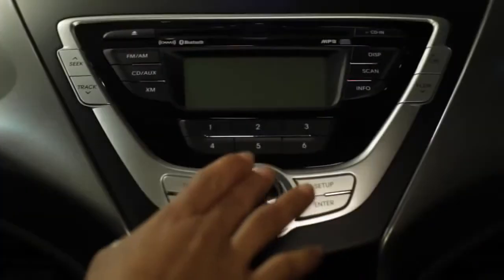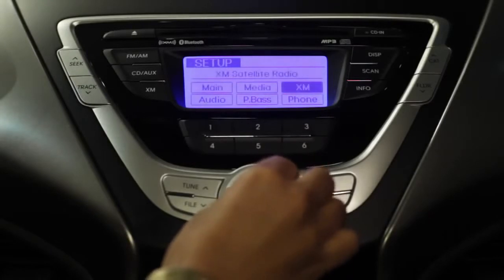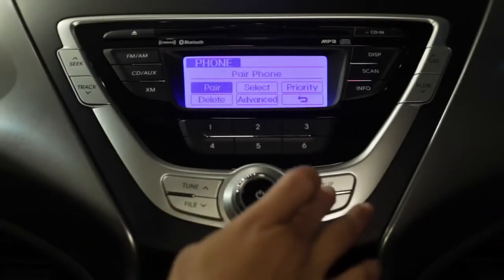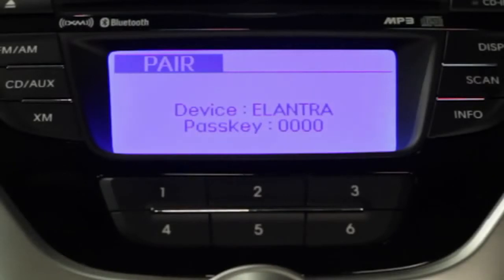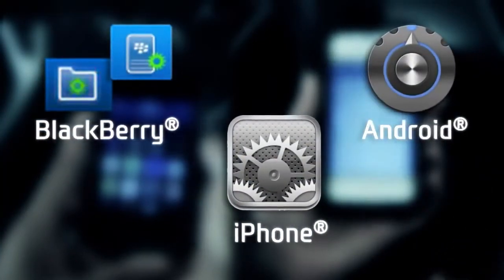Your Hyundai may or may not be equipped with a navigation system. We're going to look at both, but let's get started with how to use Bluetooth on a vehicle that doesn't have nav. With the car started and the stereo on, press the Setup button, next select Phone, and then select Pair. You'll see the passkey code used by all Hyundai models, which is 0000. Now that the car is ready for pairing, you'll have to get your phone ready for pairing too. On your phone, go to the icon that allows you to manage connections — it will probably be an option that says something like Setup or Settings.